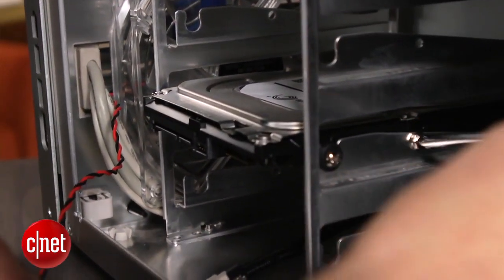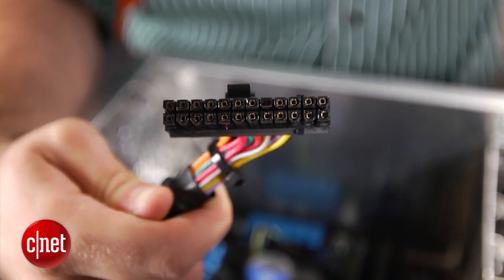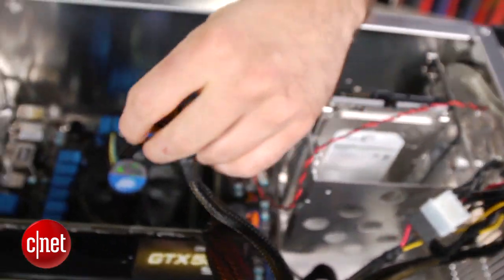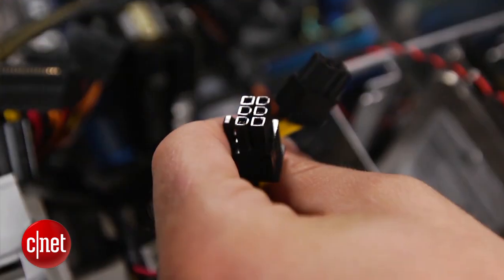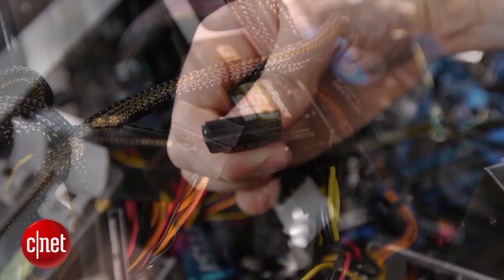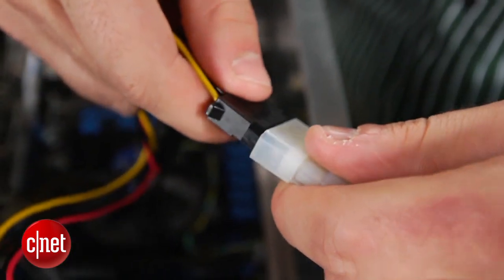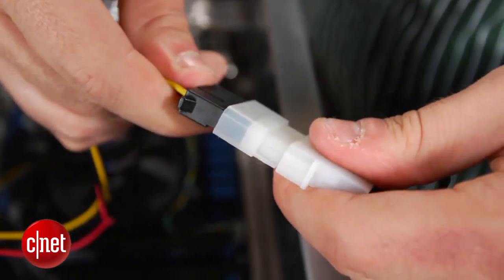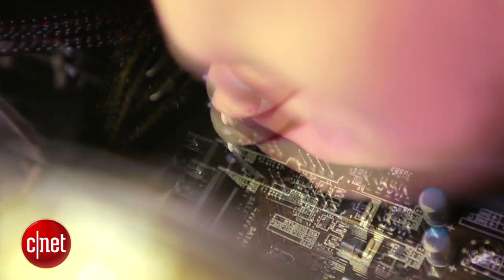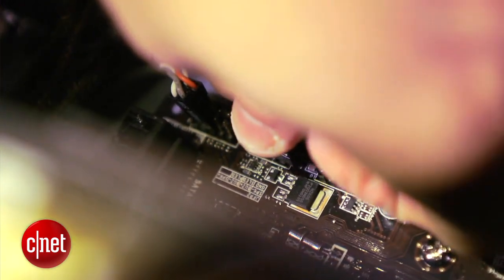Once everything is installed, it's time to bring the system to life. Your power supply will come with either a 24-pin or 20-plus-4-pin adapter — this plugs into the motherboard along with a 4-pin connector which can be found near the CPU. Plug two of the 6-pin PCI connectors into the back of the graphics card. Each drive must also be connected to a SATA power cord, with the smaller cord being plugged into the motherboard, and each fan must be connected to a 4-pin Molex adapter. The power button and LED light will either be a 1- or 2-pin connector and they will plug into the first 8-pin header on the motherboard, while the 8-pin front-facing ports plug into their corresponding sockets.